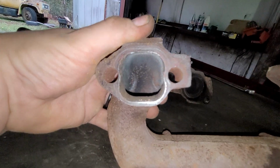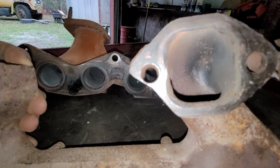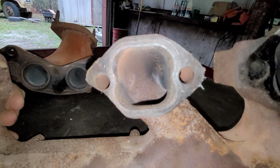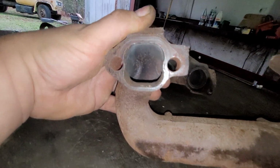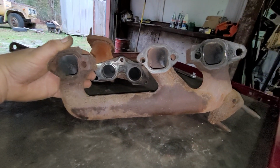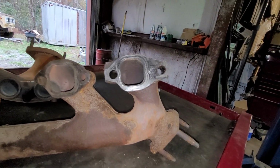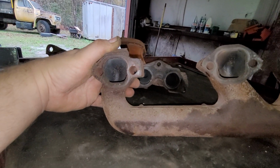Sometimes they would break the bolts. Now if you look, see the size of these holes? Now look at the size of those holes. See how small they are? The reason for that is these are the lineup bolt holes, and this would line it up in the car. So you would line those up, and then you would catch the ends. Usually it was the longer end like this. Now, had this been for a small block Chevy, like this is for a 4.3, which is basically a small block Chevy with two cylinders missing, it would have another leg over there, like this one, but further out this way. Usually it was the end legs that were a problem.